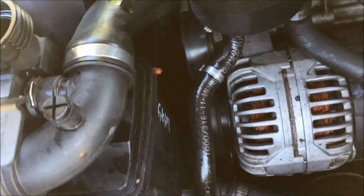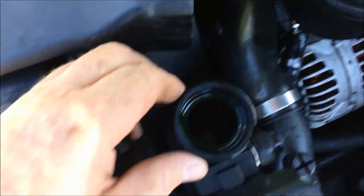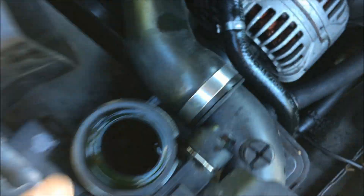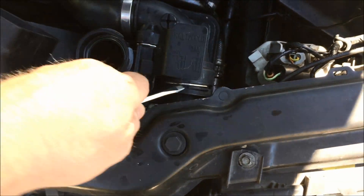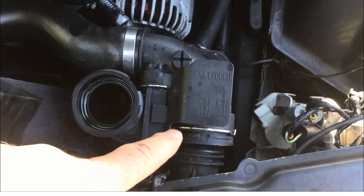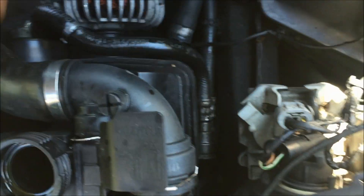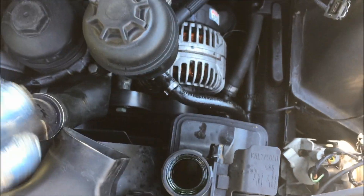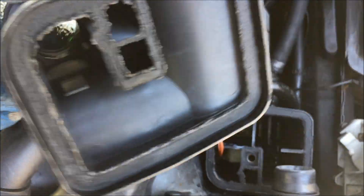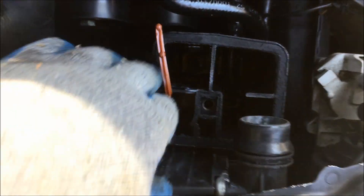As we look at this coolant reservoir tank, you can see something is wrong because the fluid level indicator is sticking out the side — definitely not normal. That should be poking up out of the top. I'm going to pop these up, pull this thing out, disconnecting it from the reservoir tank. Releasing this one disconnects it from the radiator; releasing that one disconnects it from the reservoir. We also have one down here and two underneath. Here's the fluid indicator — completely bent.